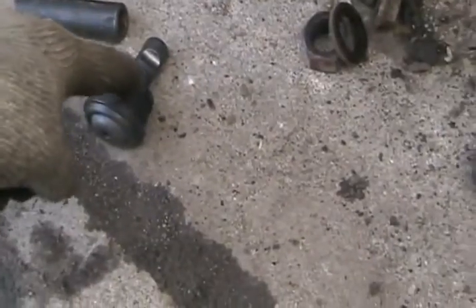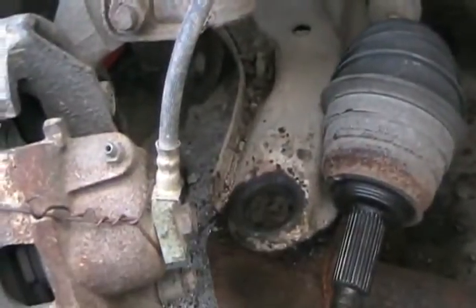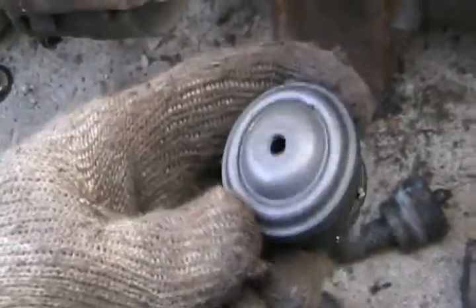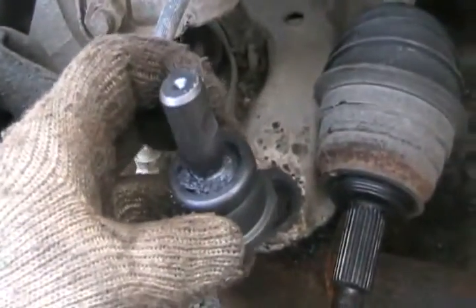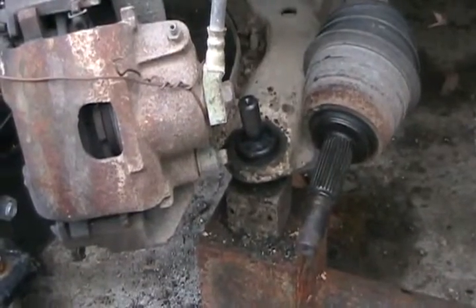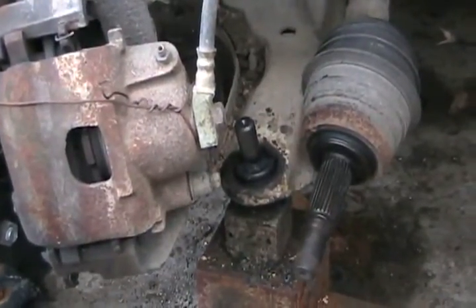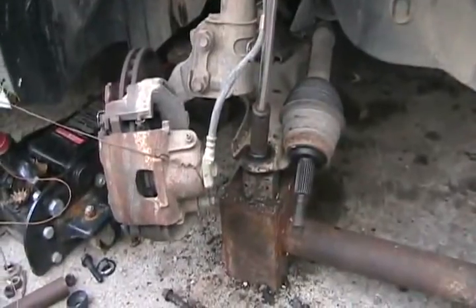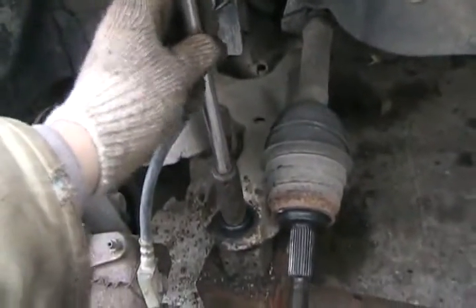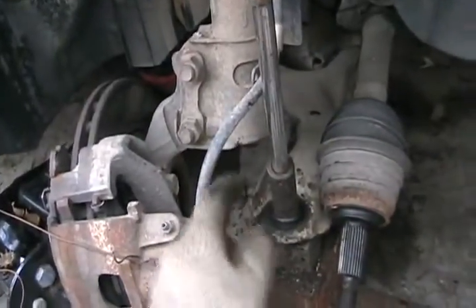I prefer to put a tiny bit of grease around that tapered edge. Then I jack it back up so the control arm is off the block, move the block over, and without installing the grease nipple yet, put the block on here and lower it down until the control arm is sitting about completely level so the ball joint can try to get itself in straight. I've just set that ball joint in by hand. Now I'm going to slowly lower the vehicle — there will be a fair bit of force on it, then I'll be ready to pound it back in. Now the weight's on it, so that block is pushing it up and holding it in. I've got an ordinary socket on an extension. The trick to getting it to go back in is steering it in.